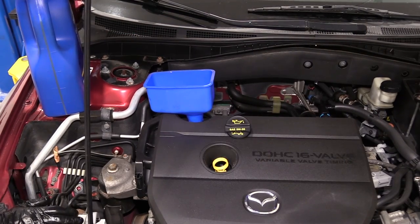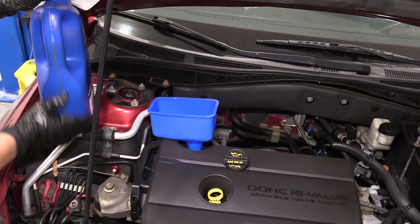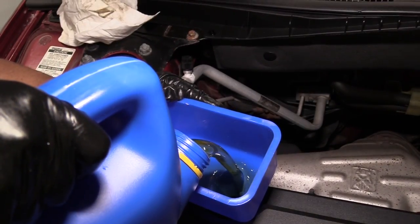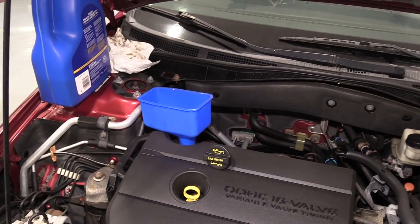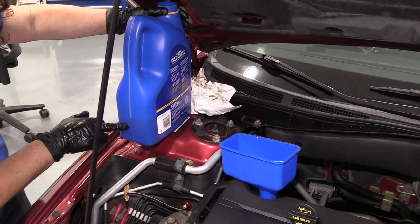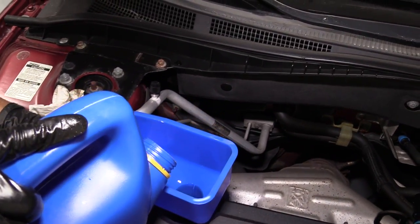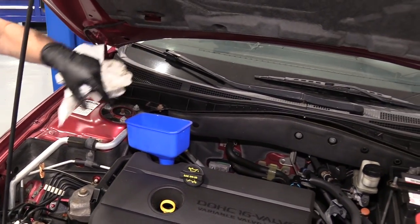This Mazda 2.3 liter takes four and a half quarts with a new filter cartridge. I have a five quart jug here, so I'm going to add four quarts to be safe and then really eye the last half quart. I'm going to see where my level is on my jug — on a leveled surface I have another full quart to go because I'm right at the half, so I need to go right at this mark. Another half a quart to go and it'll be there. It's perfect. So I'm going to set this aside and let my funnel finish draining into that.